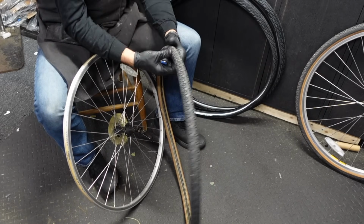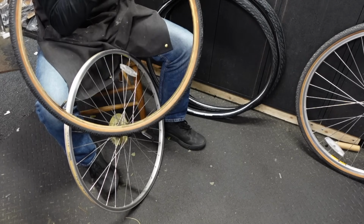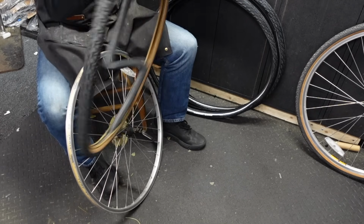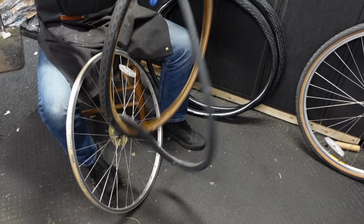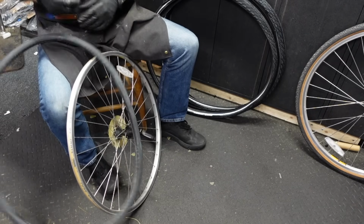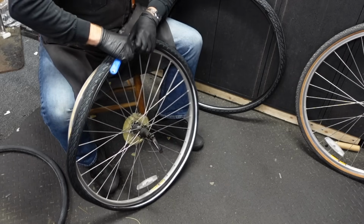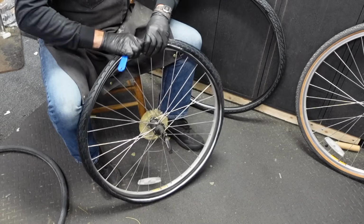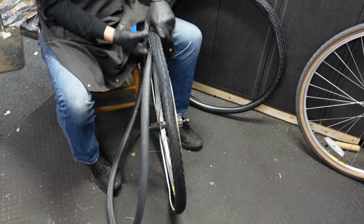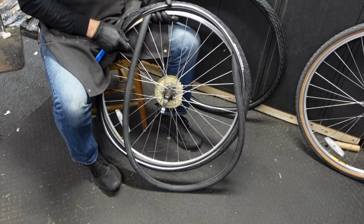And I'm replacing these tires with a little bit wider tire. I mean, these say they're 38s that I'm pulling off and I'm putting 38s on, but I think the 38s that I'm putting on are gonna actually measure wider. And they're all black, so they're gonna look a little wider. I think overall it's gonna give the bike a better look. A little bit different ride feel too. But I'm putting on these Giant PX2s. Nice general purpose, all-arounder, moderately puncture resistant, good hybrid tire. Nothing too roady, nothing too aggressive. It's just enough tread to give people the confidence they need out on the Glacial Drumlin bicycle trail, then the crushed limestone.